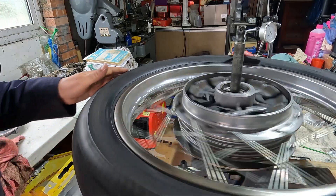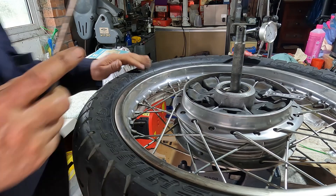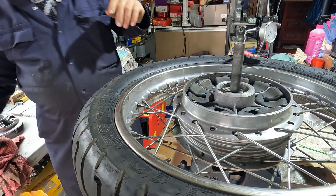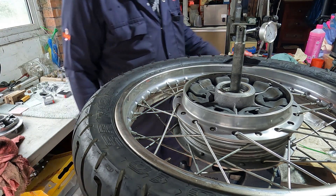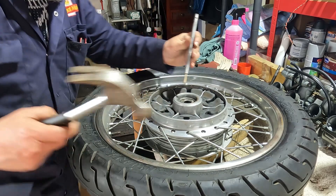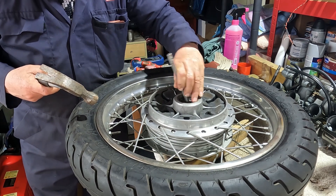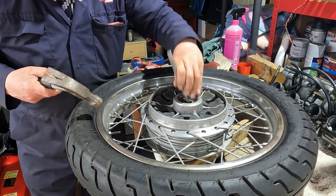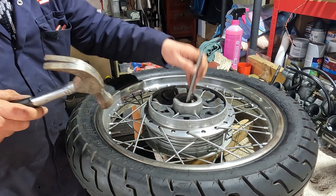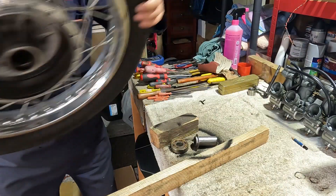These wheels may need to be re-chromed eventually, but it's pretty accurate now. Let's take the gauge away and spin the wheel to see if we can see anything by eye. Looks pretty good. Looking through the spokes I can see there is a spot where it does quiver a bit, but the wheel's not too bad. I'm not happy with this tire though - as soon as it goes down to the legal limit, this tire is coming off. Now I need to take the bearings out. I've got the wheel on the bench and I've got my drift here. The trick is to use this narrow end and tap a couple of taps when I find the bearing at 12 o'clock, and a couple of taps on the other side - and that bearing should have popped out.